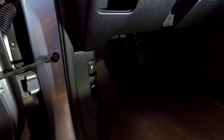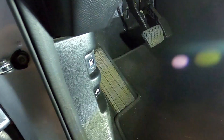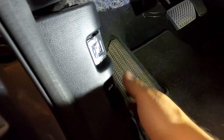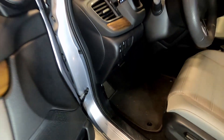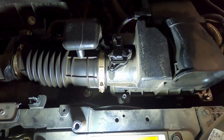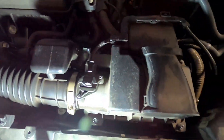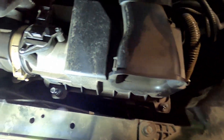It's fairly simple, so let's get started. The first step is to go to your driver's seat and pull the hood release — it's right here. Pull that to check your engine air filter. Go around to the front of your vehicle and look for your air box, which will be right in front to the right as you're looking at your car or SUV. It's going to have four screws.